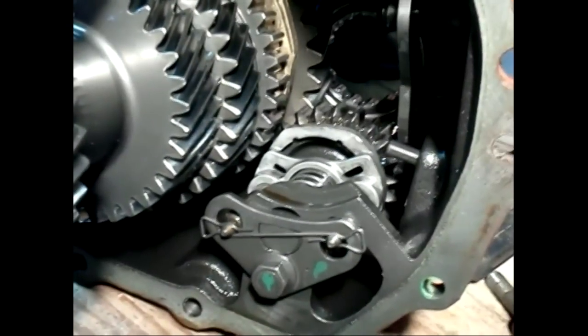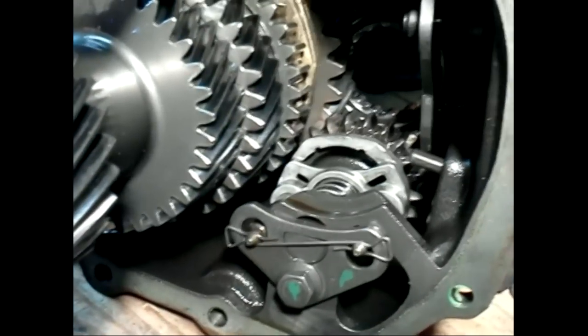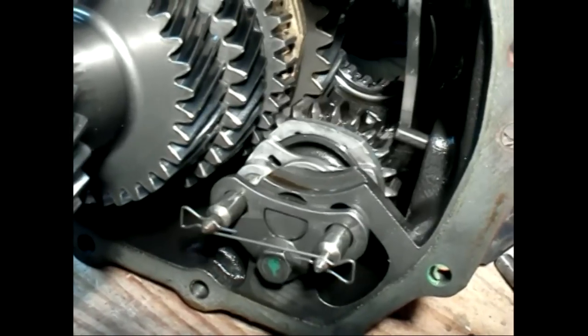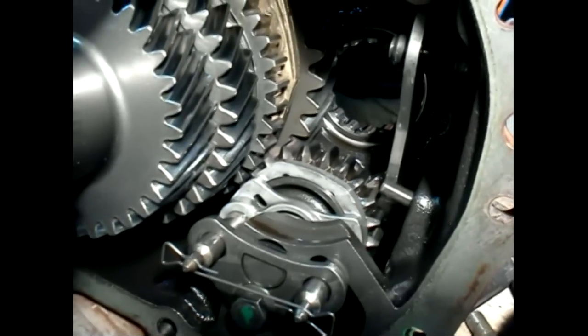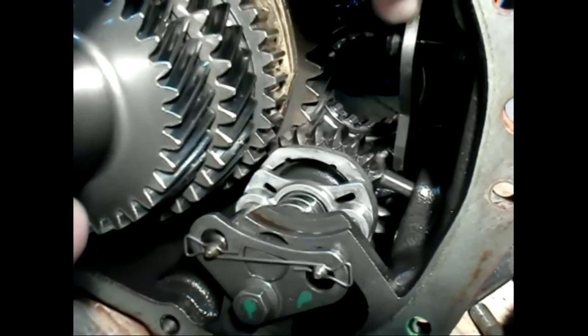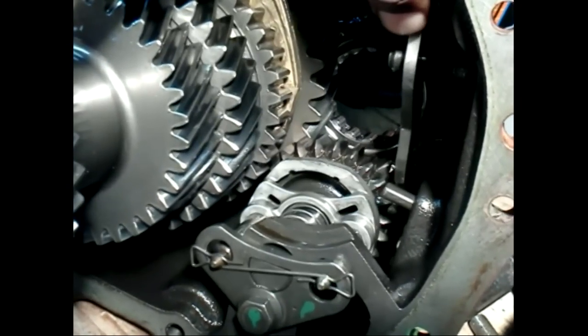You must depress the clutch to allow the idler gear to synchronize with the input shaft and the shift collar. This is because the input shaft spins with the engine when the clutch is engaged and stops when the clutch is disengaged. Even with the engine off, synchronization may not be possible due to the fact that the input shaft needs to be free to move for synchronization.